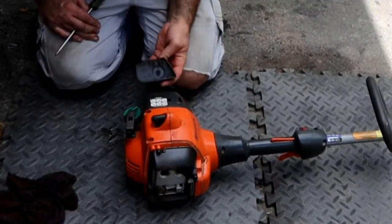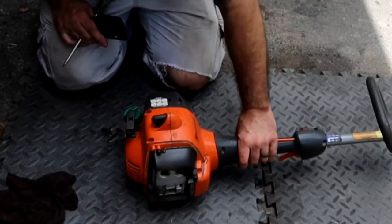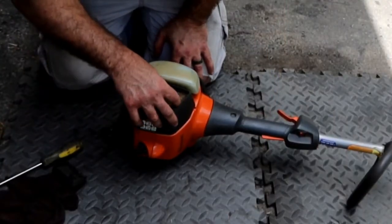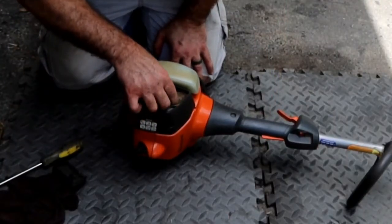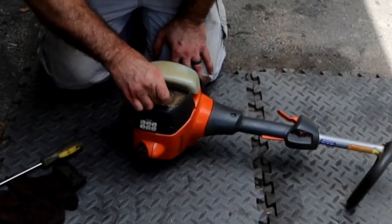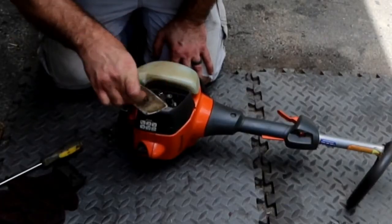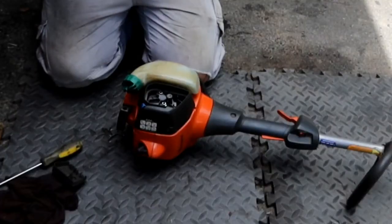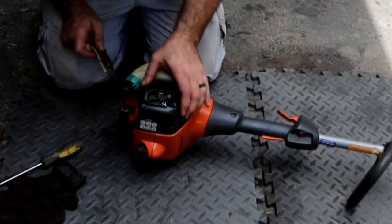Had I not seen it stumbling, I would have said, oh, well, no trouble found. Air filter's pretty dirty. Again, it wouldn't change based on temperature. Items I was naming before could have changed based on temperature. So let's get that. Got a new one of those filters. I can put a new one in while I'm at it.